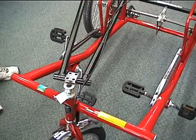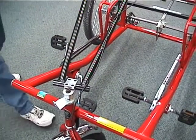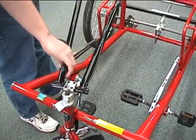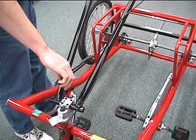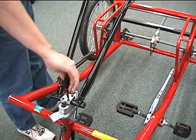This is your Team Dual Trike All-In Packed. The first thing we are going to do is adjust the handlebar. It is as simple as loosening up the four allen bolts on the top plate of the handlebar stem, adjusting the handlebar angle to the angle that you would like, and tightening up the four bolts.